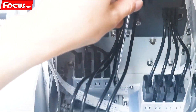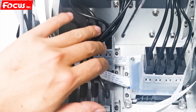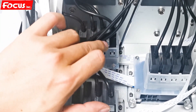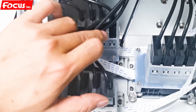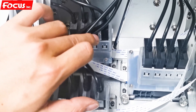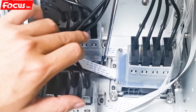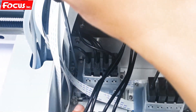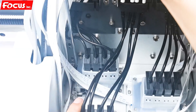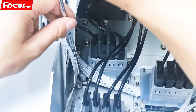We loosen the four screws. Remember, we just loosen the screws of the print head adapter board, not the print head itself. We loosen this one a little bit, and this one a little bit. Also on the back at the left side — this one a little bit, and then this one a little bit.